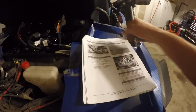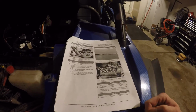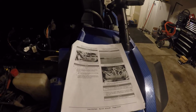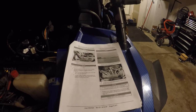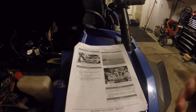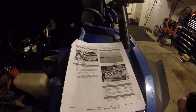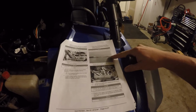Once you got that, next on page 5, I guess it's just a continuation of further instructing you how to transfer the pins in the 32 pin connector, and plugging it into your harness or setting it aside. That is still the front part of the harness that's connected to that 32 pin connector. Probably the hardest part in the whole thing is joining these two.